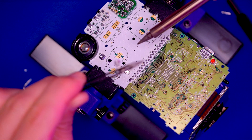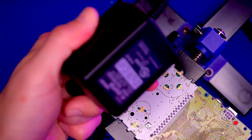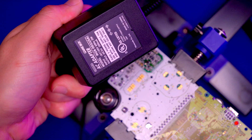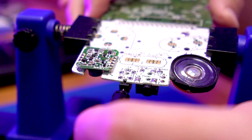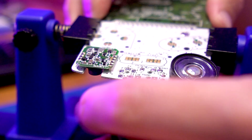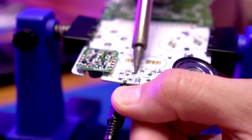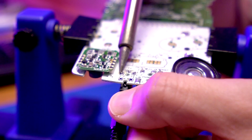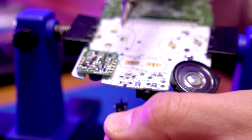So that's removed. If you have a Game Boy Color power adapter available, insert it into the jack — this is a little trick that will help us desolder it the rest of the way. When you insert it, apply downward pressure while heating up each of the pads, and little by little you'll be able to remove the power jack from the motherboard.